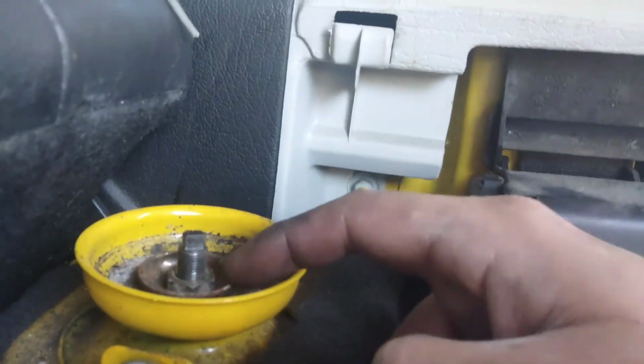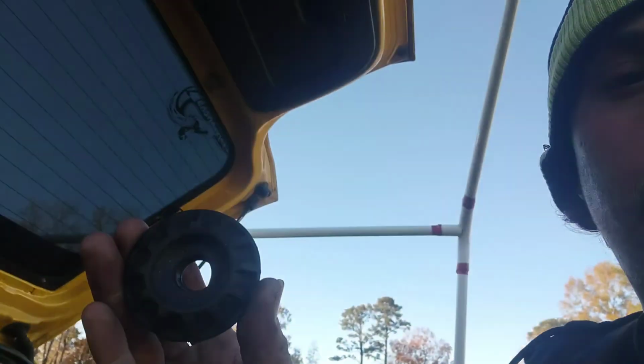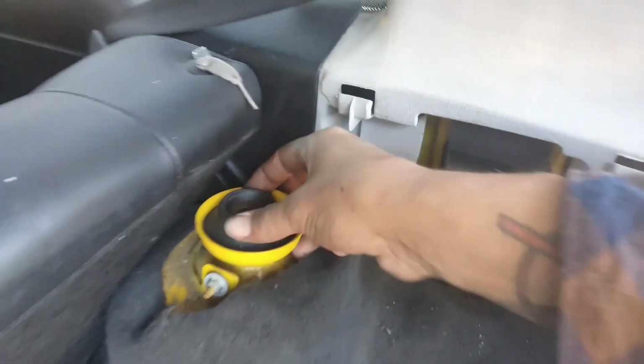Okay. So if you look right down in here, there's supposed to be a rubber piece. Oh, where'd it go? I had it in there, right there. So this rubber piece right here is supposed to go in here like that and sit down, and then that washer that's down in there is supposed to basically sandwich this bushing down under there somewhere. But if you notice, even with me already tightening this as much as I can, I can't get the shaft out. So again, another problem for $200 coilovers. Be very aware that you might have to really rig some stuff to make it work. I was going to be emailing them, and I might actually ask for a partial refund because this has turned into a real big aggravation. But back to the rest of the video.